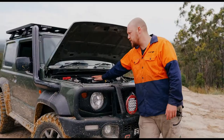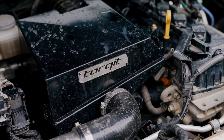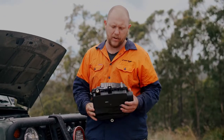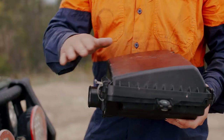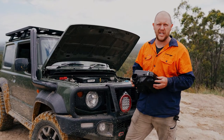For our air box we've also gone for 304 stainless steel, so it's not going to rust and obviously it's much tougher than the factory plastic. The factory air box is prone to cracking, and especially with heat it's going to warp as well. They do tend to start letting in a lot of dust and can't be trusted for water in most applications either.